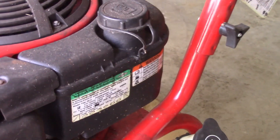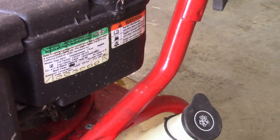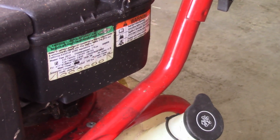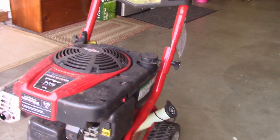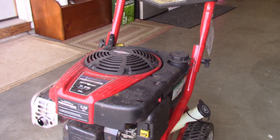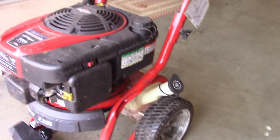The unit is best tilted on the side when you go to replace the pump — you can see the water dripping down here. You'll want to either empty the gas tank or make sure it's not full enough that when you tilt it on the side it's going to spill out. I'm going to tilt it so that the gas cap is on top, tilting it to the left so the gas goes down into the lower portion of the tank. It's pretty much empty anyway, but just an important safety tip.